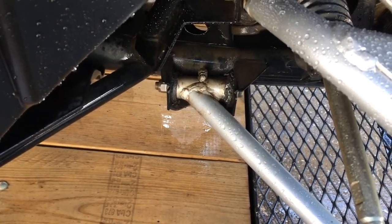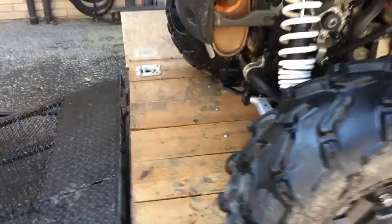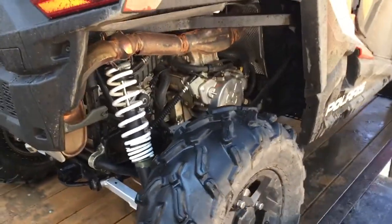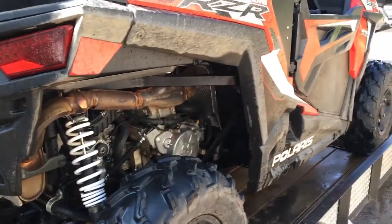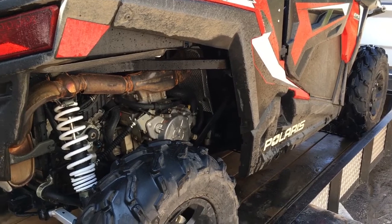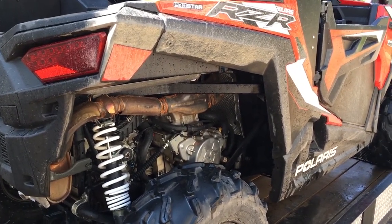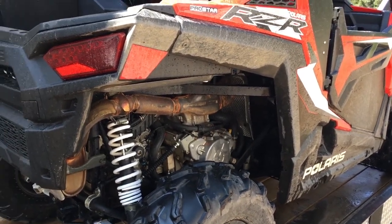If it's hanging in big gobs or something, yeah, fine. But the grease, as far as I'm concerned, is protecting that seal. It's keeping water out to some extent and holding the grease in. So I don't go prodding around in there too much, wiping that out. You can if you want. The grease is meant to be there and it's not bothering me. Over the winter when I clean my machine and it sits for a few months, then I clean all that up so it looks pretty. But other than that, I don't worry about that stuff too much.